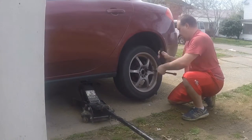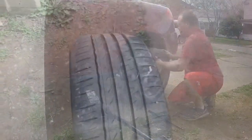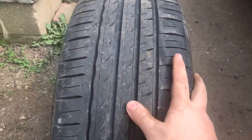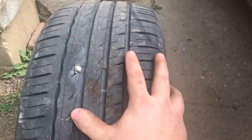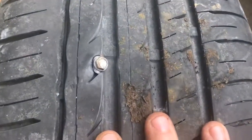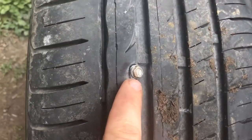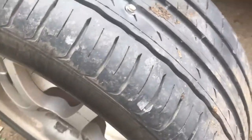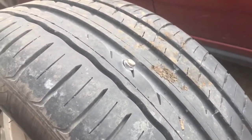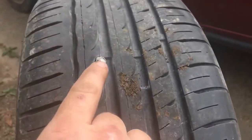The tire is wobbly and ready to come off. Next, inspect the tire — just roll it until you see anything suspicious. Right here we can see a roofing screw. We had just had our roof done and the workers left a screw behind. Remember: only plug the tire if the damage is on the tread, not the sidewall. This tire has plenty of tread left.